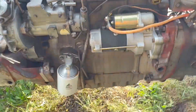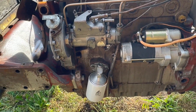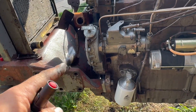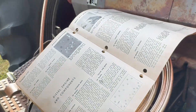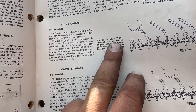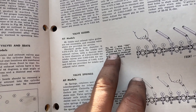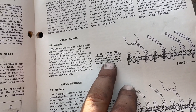You can see the line and the indicator on the back of the block — TDC. This is a diesel; it's the same motor as the 175, this is a 180. If it had a gas motor, the timing marks would be on the crank pulley itself. There's not a whole lot in the book about adjusting the valves; I have two diagrams here.